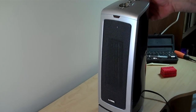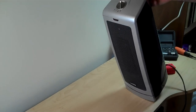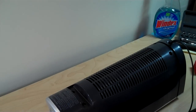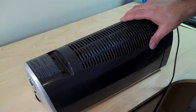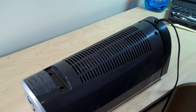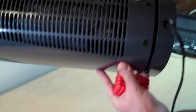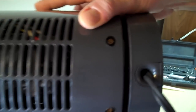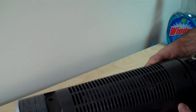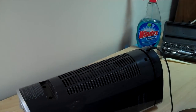Playing around with these, taking things apart that broke, I figured out that if you take these apart, the ceramic element is usually clogged up on the back side. So all you have to do is clean it — you don't need to go buy a new one. This particular one has security screws, and security screws are just for that — to keep you out.